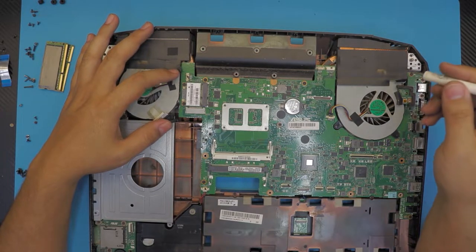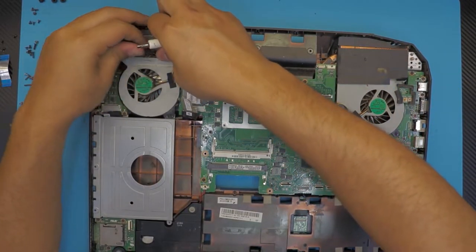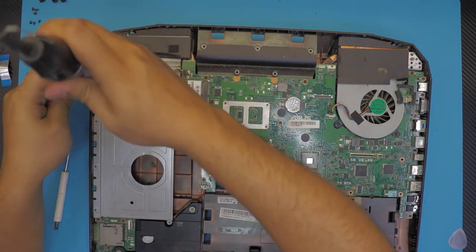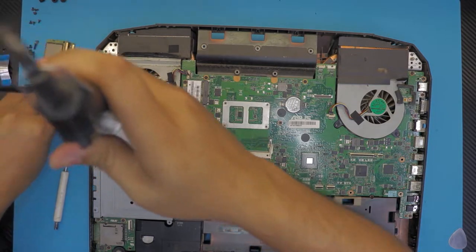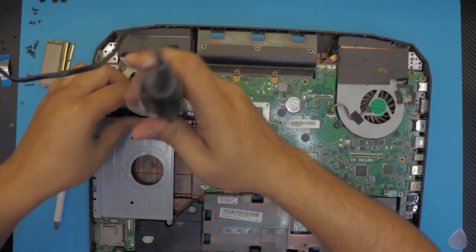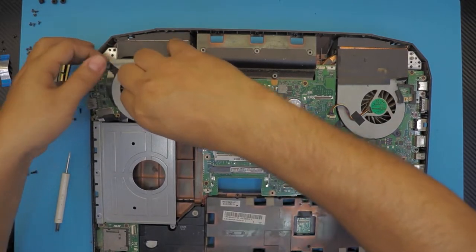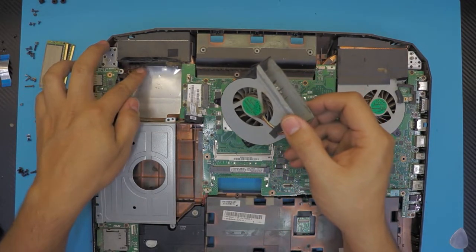We're gonna unhook the motherboard. Before we unhook the motherboard, you gotta loosen up this one. Let's start from this end, removing the USB hub right here. There we go. Loosen up the fan, there's only two screws. Pull up the fan, this is a humongous fan. Wow.